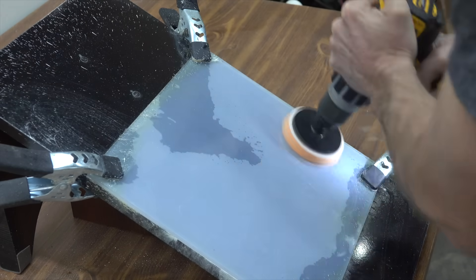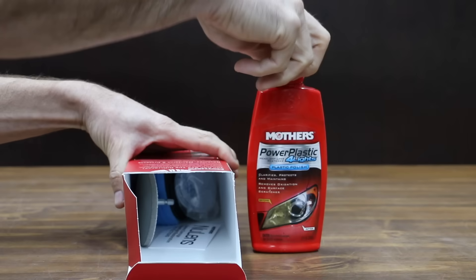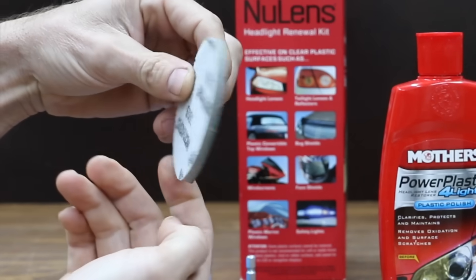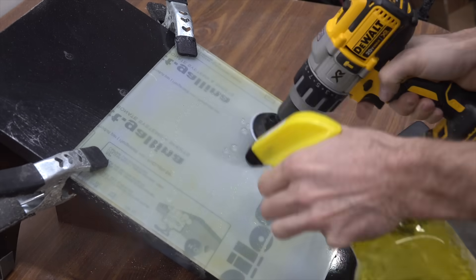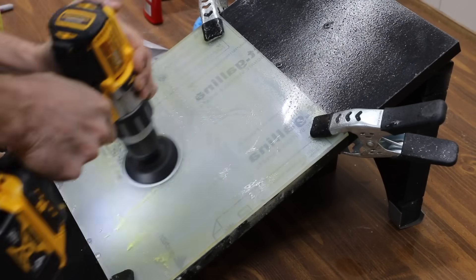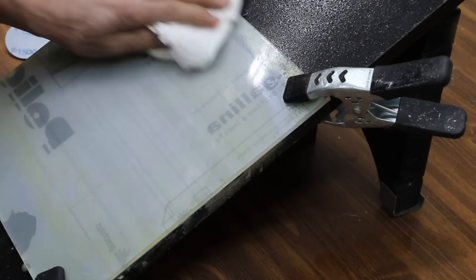Costing $14.70 is the Mothers New Lens Headlight Renewal Kit, which claims to be fast and easy and is made in the USA. It includes Power Plastic 4 Lights plastic polish, a backing plate, a Powerball for Lights, and a 3-inch Soft Flex backing plate, with 2 pieces of 800, 2 pieces of 1500, and 1 piece of 3000 grit sandpaper. Step 1 — Eliminating Pitting and Major Defects: center and attach the 800 grit sanding disc, spray liberal amounts of water on the lens surface, hold the drill flat at 400–600 RPM using light to moderate pressure, and sand in back and forth overlapping motions. Wipe the lens dry and inspect — it should have an even visible haze throughout.